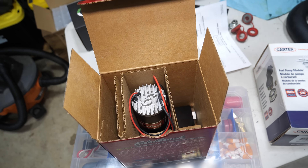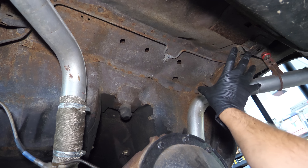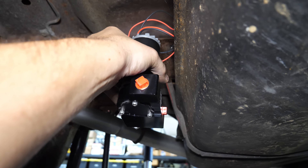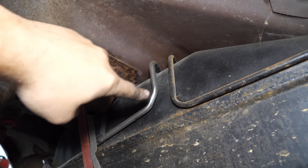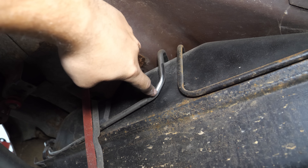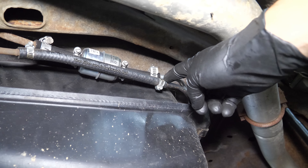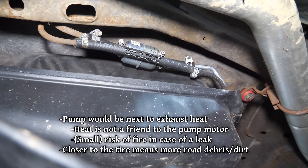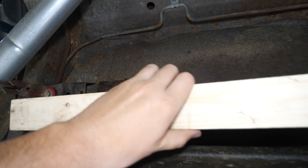This is what we've ended up with to run our engine — it has to be mounted as low as possible near the gas tank. I think I know generally where to put it because there's a decent amount of space right in front of the gas tank where the factory exhaust system hung the muffler. A number of years ago I replaced the sender in the gas tank, and the easiest way to get gas to the pump is just to cut into that line. Otherwise we'd have to loop a line back for a centrally mounted pump, which for a couple of reasons I decided not to do. So if we're going for a front-of-tank mount, this calls for a bracket.